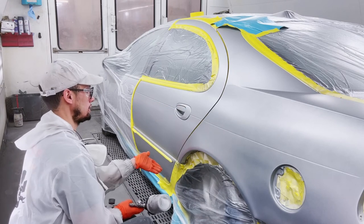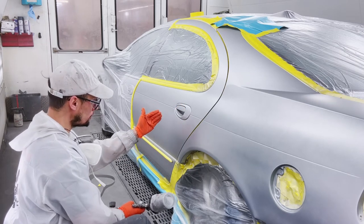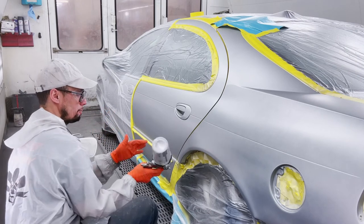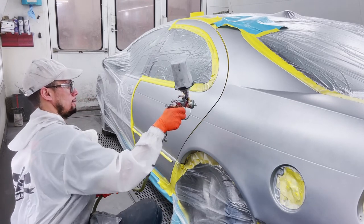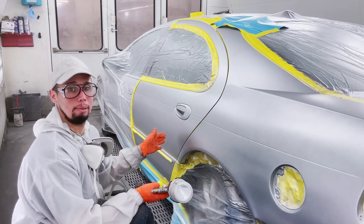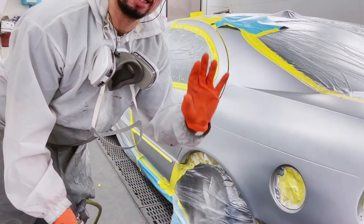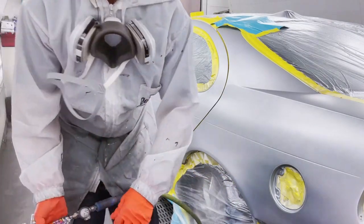On this edge, I'm putting the paint on this edge and then I put two or three coats staying close to the back of the door. When I'm starting to finish the amount of paint I have to put on these panels, what I'll do is flare out the gun this way by hitting the trigger and letting it go. I'm doing it — it's just because I don't let it go all the way and there's still a little bit of air going through it as I'm blending it. So I put paint all on this panel and then on this panel, I stay close to the edge and I blend it out — it transitions smoothly and easily and seamlessly. That's how you do it.